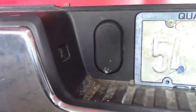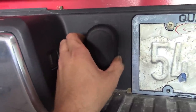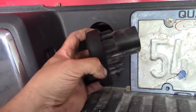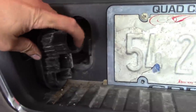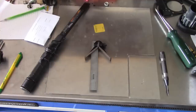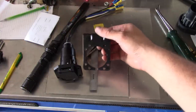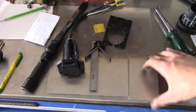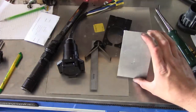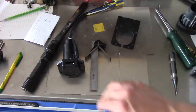I used these bar clamps to pull it up into place, so I've got bolts on either side so it can't go anywhere. The next step is wiring. Next to the license plate there's a little cap — if you have the factory towing package that's where your trailer connector would be located. You can buy a replacement connector that fits right into this hole, but they don't have the pigtail for the back side of it. So what we're going to use is a generic seven-pin receptacle with a mounting bracket. I think it'd be better to put it in the same location as the factory connector. I grabbed a sheet of aluminum — about 60 thousandths thick — and laid out the same pattern from the bracket to cut a little plate to go where this thing was.